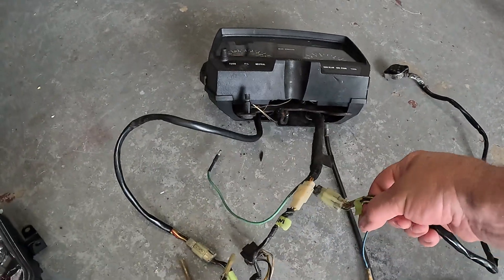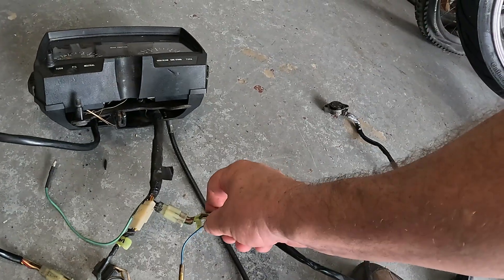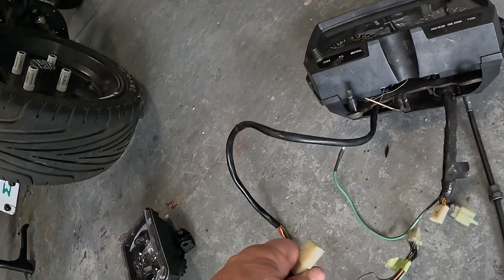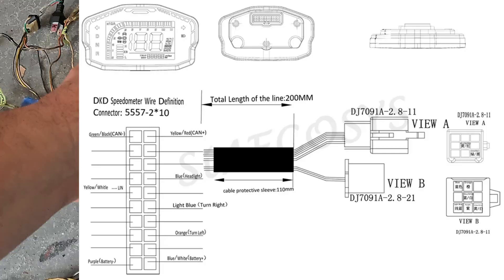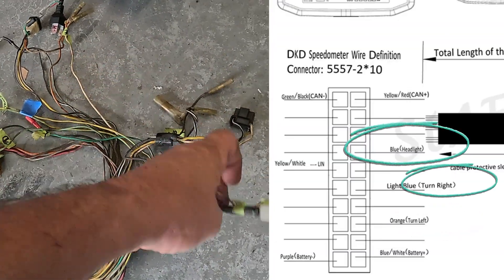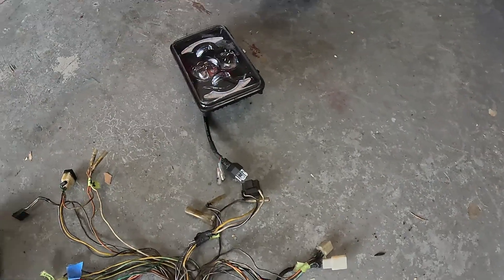At first you'd think we don't need any of the instrument cluster — toss it away — but we actually do need some wires in here. Some wires went to the transmission for the gear position signal. This wiring harness going to the instrument panel — I've marked both connectors as 'instrument panel.' What makes these important: if you're doing a DKD display, in here you have your high beam indicator, left turn signal, and right turn signal — three wires you definitely want. You'll need a multimeter to find which ones they are — turn your turn signal on and see which ones give you 12 volts.